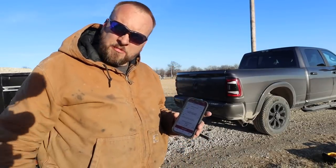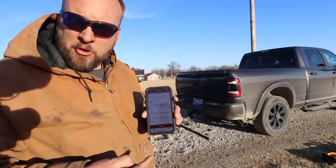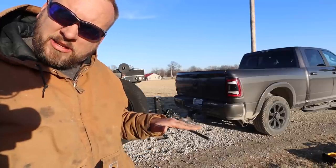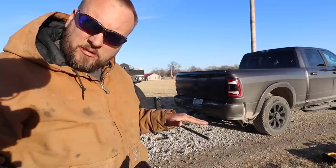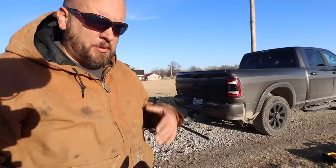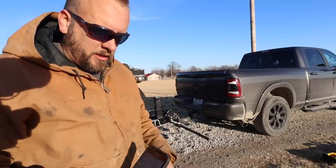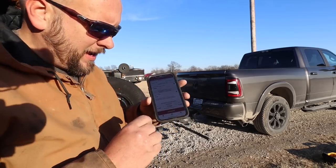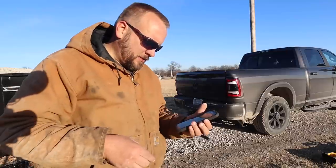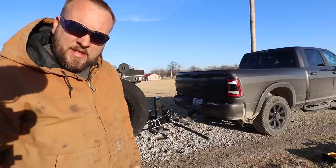That took me about two minutes to take all those measurements. I don't have to take these measurements every time — they'll be saved on the app. One interesting thing is that just by leveling the trailer out, my tongue weight went from 1,400 pounds to 1,600 pounds. That's just the difference of having the load level — it actually shifts more weight onto the truck and puts me already up to my payload capacity with just me and the vehicle, no tools, no other passengers. I put all this information in the app — tongue weight, trailer weight, pin weight, measurements — and it says my gauge needs to read 2,450 pounds.